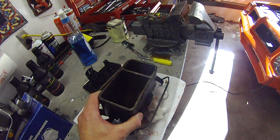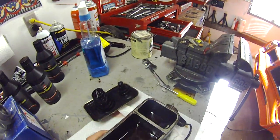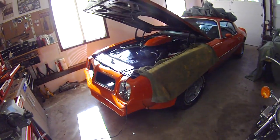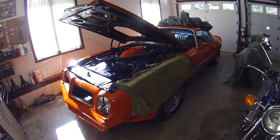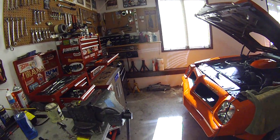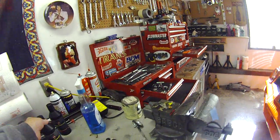I don't know if you can see this too well, but there's rust and there's goop. Interestingly, this is DOT 5 silicone — I used silicone in this system when I rebuilt it. It now has all new stainless steel lines, new everything. You don't want to mix DOT 5 silicone with other brake fluid, but if you're starting from scratch you can use the silicone.